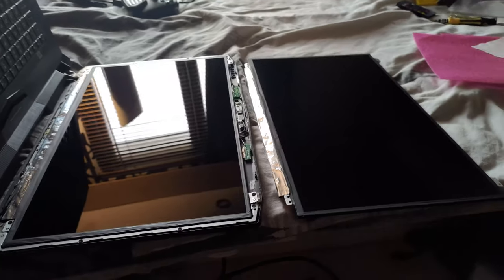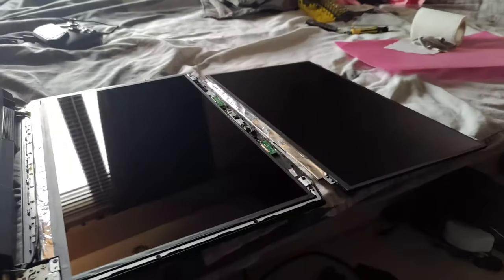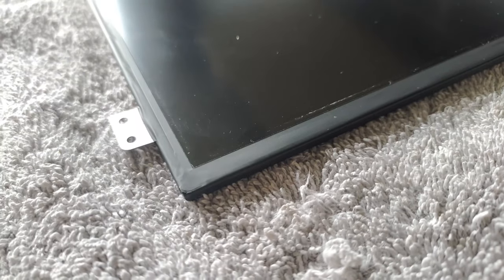All you need is some warm water, a spraying bottle, a roll of toilet paper, lint-free cloth, and around 6 hours of your time. Get your panel and make sure all the cables are disconnected. Insulate any ports or sockets to prevent any water seeping in. Now, as you can see here, I insulated my 40-pin connector socket with electrical tape. This is to make sure it doesn't get wet or any of the water seeps in.